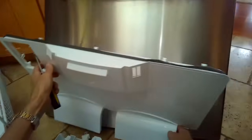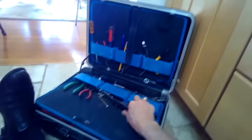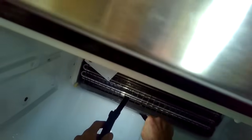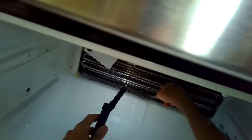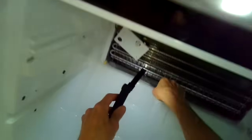About every eight to twelve hours there's a little heater that kicks in and it melts ice on the evaporator. Then that water drains into a trough and drains underneath your refrigerator. In this one, that little hole that it drains through was plugged with ice. So the ice accumulated, and now I've got to use my paint scraper to break up the ice. Just take your time here — be careful not to hit the silver part above it, the evaporator. It's kind of fragile.